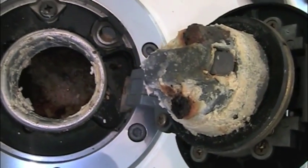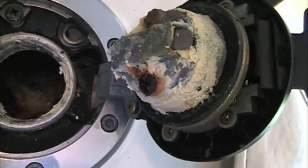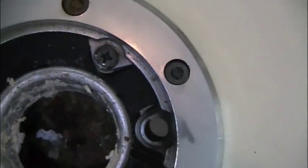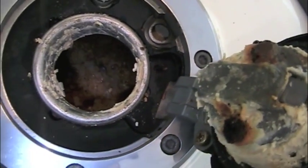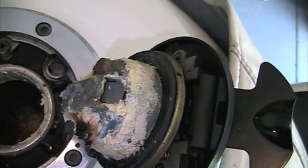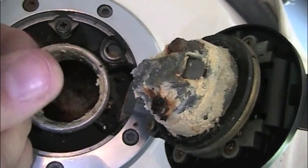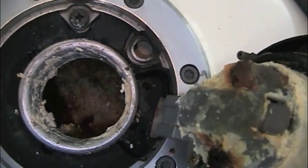This is a very unpleasant surprise — bad fuel, old fuel residue that's built up on the inside lining of the tank. Very fortunately, just by the luck of the draw, if you can see that shiny piece down the middle, this tank is made of aluminum, so you're not going to get rust issues. As you can see, these two screws have both rusted quite dramatically from the moisture that the fuel — or the ethanol, I'm assuming — absorbed, causing this gooey stuff to build up.